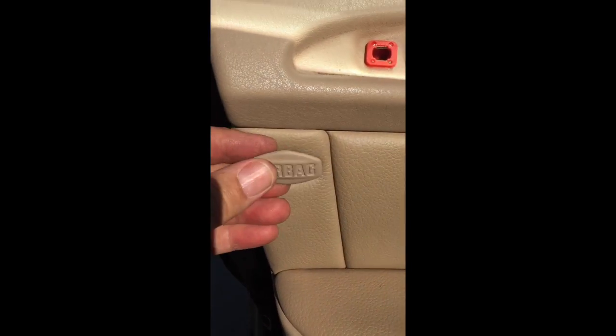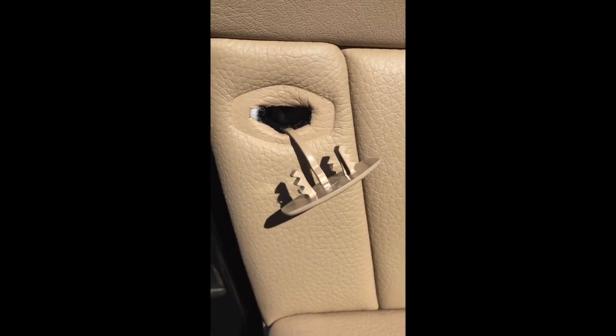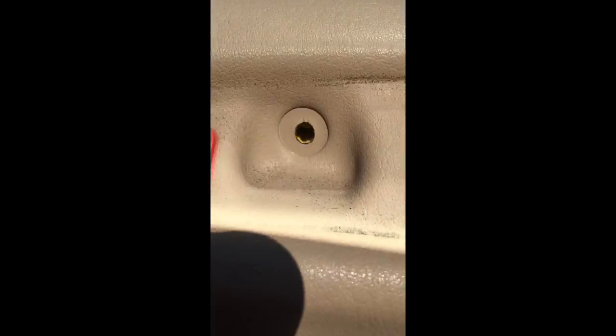A little airbag clip here is a trick. There's a torx screw in behind there, and the wood grain or black — whatever you have — cover, you need to take that off, just prying it from the back. It came off quite easily, and there's a torx screw that was in there, and then another one down behind the handle.